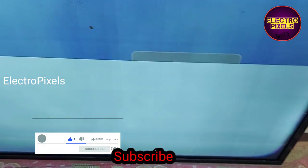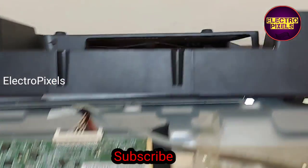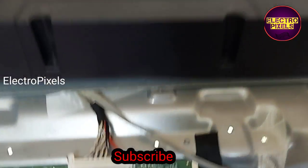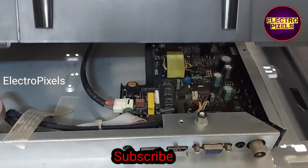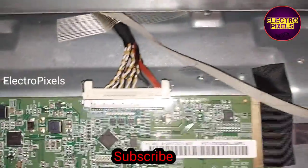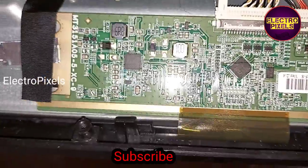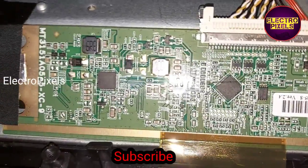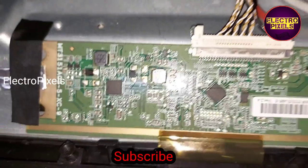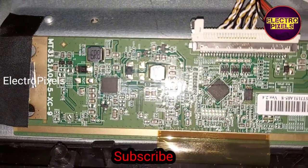In this TV you can see there is a fold and there is no graphics on the panel. Here the display shows a white shading picture. While checking the panel, on the tcon board here all voltages are okay.